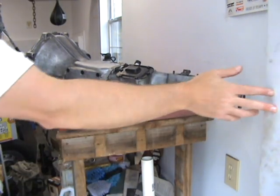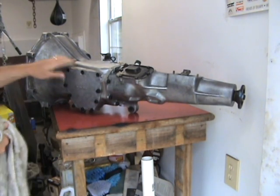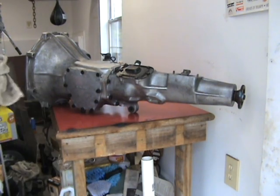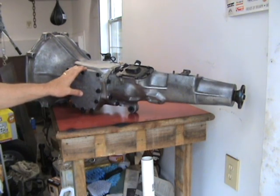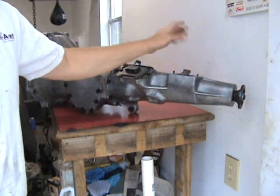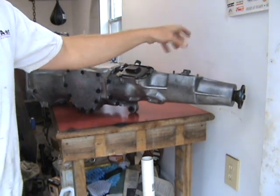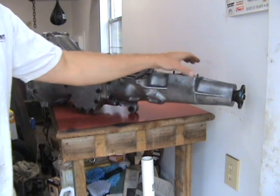Okay, that about does it for the rebuilding of the MGB gearbox. This is the MGB gearbox, or MGA, just a little bit of difference as noted in the DVD earlier in the film. But some final things. As you know, you're going to put this back into the MGB or MGA. Again, for your remote tower, just make sure you put oil in here and on the bushing. Put the remote tower on, grease on the gasket, and final prep, rubbing alcohol to clean the surface. And you'll be doing all this through the tunnel, and just put the gasket on the remote tower, just torque down the bolts to spec. I don't think there is a spec on them, but just crank them down about yay tight.